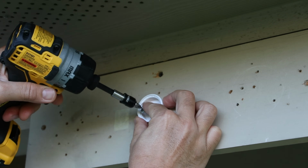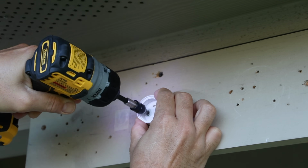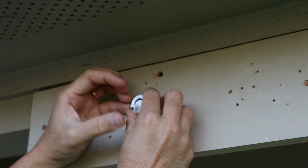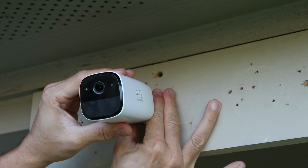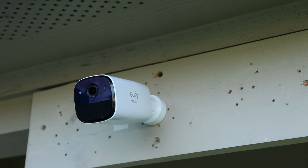Also take note that the camera that I received barely has any charge, so you have to initially charge the cameras for at least 8 hours before installing it outside. Installing this is pretty straightforward. Screw in the lower part of the mount to the wall, put in the ball holder, then mount arm, and tighten the mount so that you can screw in the camera. Adjust the position and tighten the mount to secure the camera in place.